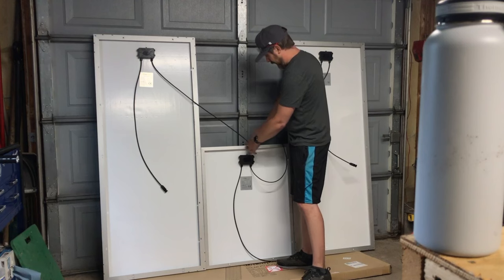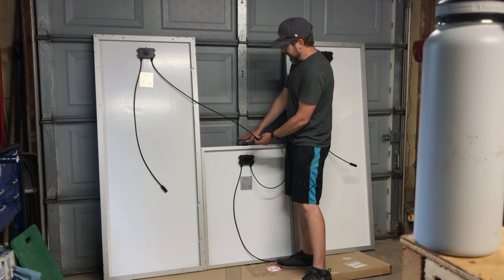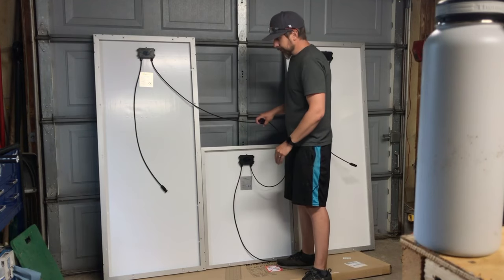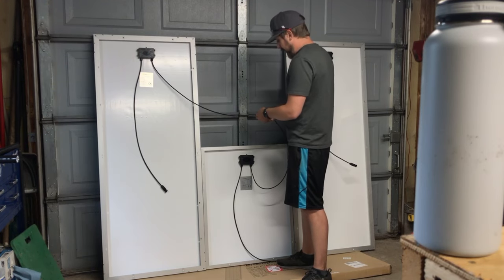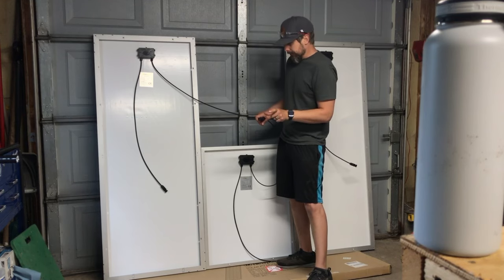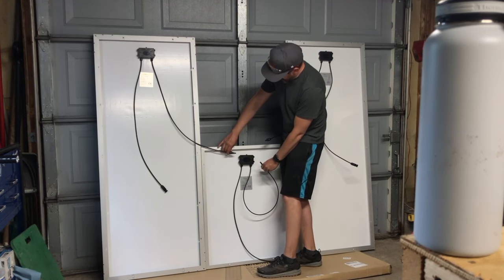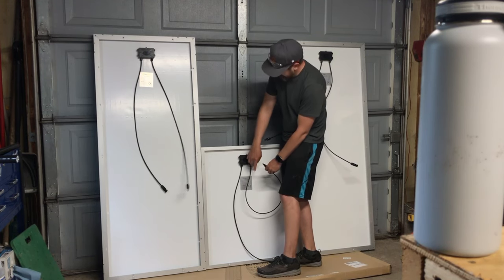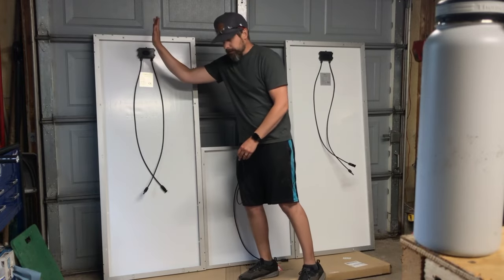So then I have just one positive wire and one negative wire going into the top of the trailer. I've already noticed that in order to connect these all to one spot, I end up having to kind of cross the corners, which isn't ideal because I have a fan very close to this. I may have been able to avoid that if I had flipped one of these panels. But they do make a three-to-one connector that has four, five, or six-inch pigtails, so each split has an extension. That's going to allow me to run the wires kind of close to each other. And I don't think I'll have to cut the corner like that. All of the three-to-one will connect somewhere under this panel, and then we'll run the main wire through the entry gland into the trailer.